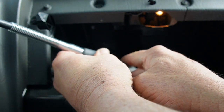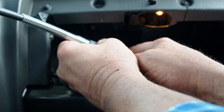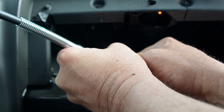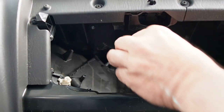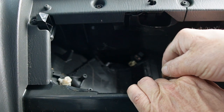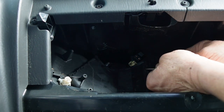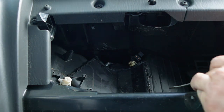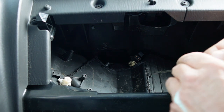We're supposed to cut it at an angle here anyway, like I'm aiming toward the driver's side headlight. It's kind of hard to get in there at an angle because of all the stuff that's in the way in a small area. Let's hope that I did not hit the heater core — I tried not to go very deep, but might not have went deep enough. And if you're using a power tool, guys, wear safety glasses. This does have some slinging plastic.